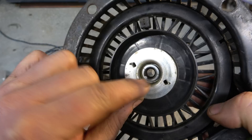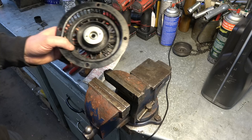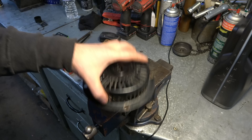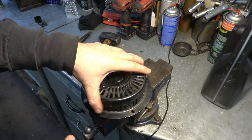This is the pin on this side. What I'm going to do now is show you how to remove that pin. Grab yourself a three-eighths and a five-sixteenths pin punch. What I like to do is open up my vise and place this part right here so that when I punch out the pin it goes through. The reason I like to use the vise is it's good support — you need the pressure on this inner part, not the outer edge of the recoil, because you will bend the recoil inwards.